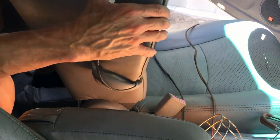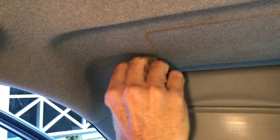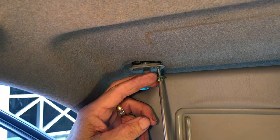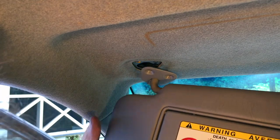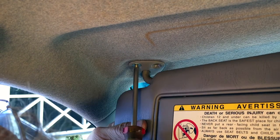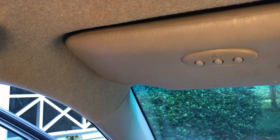And there we go — we are good. Now let's get to the sun visor. There are two Phillips head screws underneath this cover. Pull it loose and there it is. This came out of a Limited which has a light on the sun visor — mine does not, so I don't need that wire. This sun visor came off an 02 and mine's an 05, but they're both first generation so hopefully it will fit. Before putting the cover back on, let's make sure it stays up — and yes, it does. The cover goes back on to hide the screws, and the visor's done.